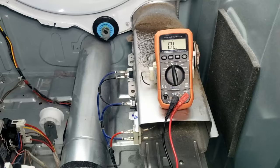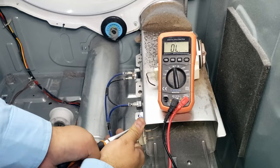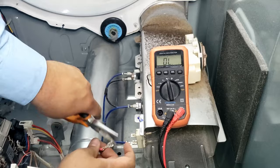We're going to set the multimeter to continuity and check for a signal on the heating element, thermostat, and high limit thermostat one by one. To do this we need to remove one connector from each of the items to ensure a good result from the sensor. If you have trouble getting a connector off, you can use a flathead screwdriver or needle nose pliers — just make sure the spade terminal isn't damaged on either the female or male side as you take it off.